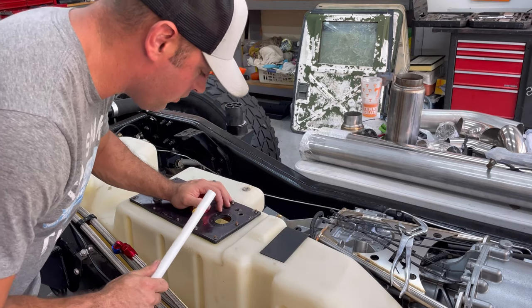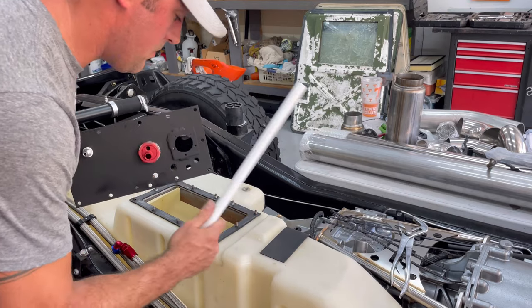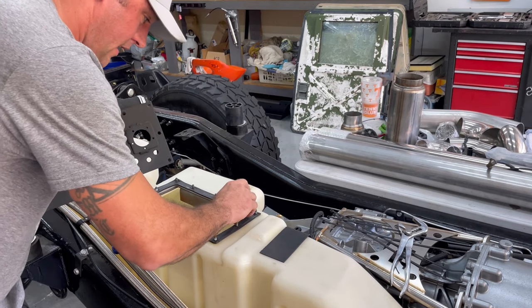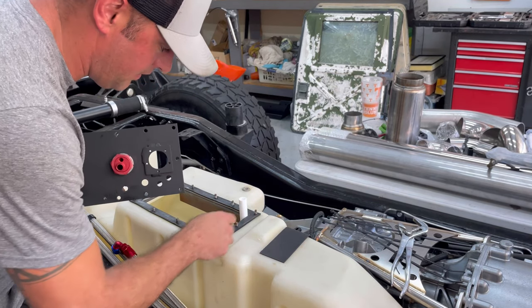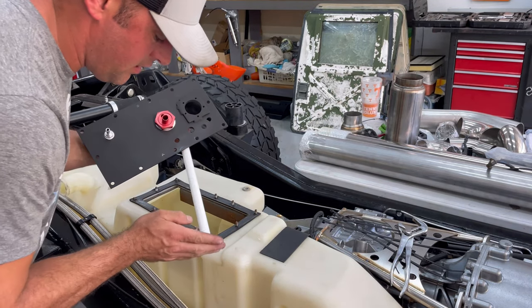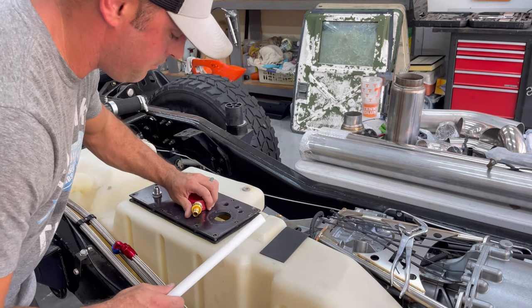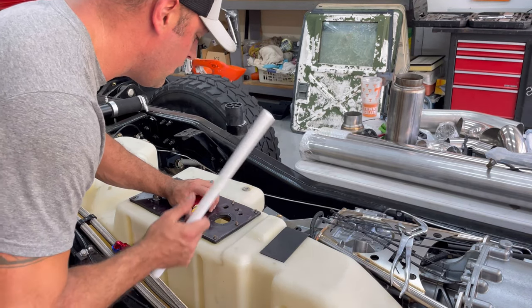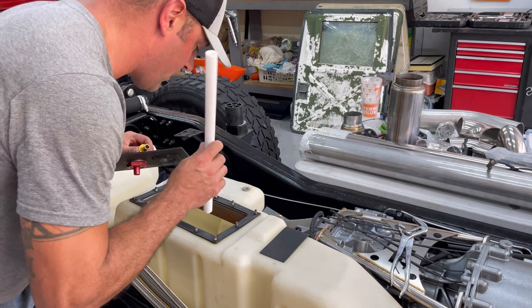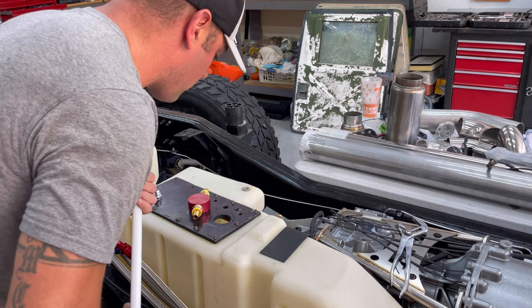Okay, so let's get this pickup tube installed right here. Now, remember, this is cut to fit. That's on the bottom. Look how much it's sticking up. So what I'm gonna do, put this on here and then just keep cutting some off slowly until it seats down perfectly. And also what I'm gonna do, put something on the bottom there where it can kind of mark where it's going. Maybe a piece of cardboard or something.